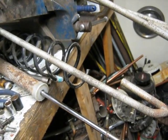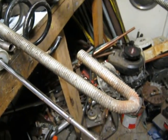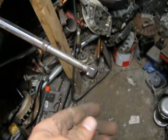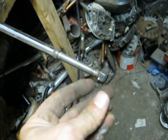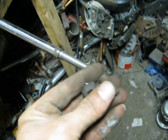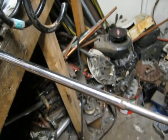I've got my homemade strut compressor here. You need a strut compressor to work on the rear struts on these Saturn L100s. The problem in high-corrosion areas is the end of the strut where the nut goes on — you're supposed to be able to grab this end with a socket and use an offset wrench, but I don't have an offset wrench the right size. So what I do is cut a zip disk off even with the top of the nut and then use a 15 millimeter socket on an impact to get it out.